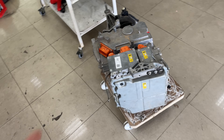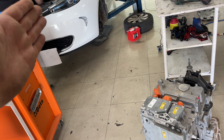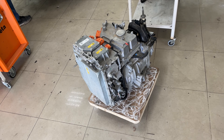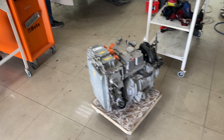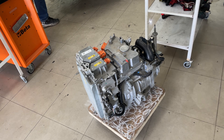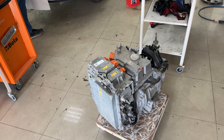The reason I mentioned this R240 drive unit is because we've already heard several times that owners changed the drive unit at around 100,000 kilometers, which was very odd. It's the same electric motor with the same problems — a lot of customers with above 100,000 kilometers had failed electric motors. That's why I was interested to check it and document everything for our viewers.